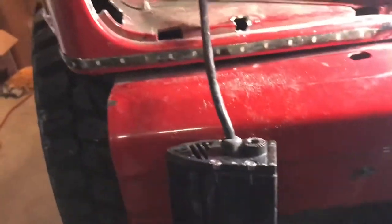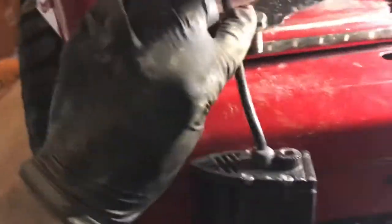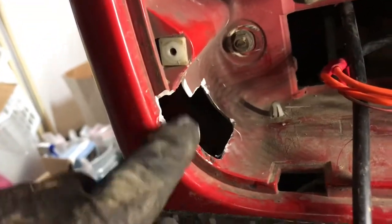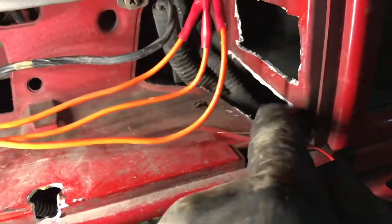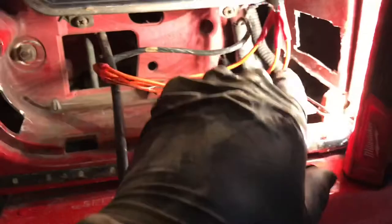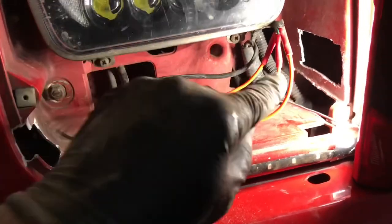You can see the overall design a little bit easier now. I drilled the hole for the bolt plus this front right up here — that's just held in by that washer. Then I cut a hole in the middle so it could slide right in and bolts up underneath like I showed earlier. You have to cut out right here to make it fit, and then here and here. So yeah, you do have to cut a lot. This is what I meant by the wiring mess I have going on. With these blinkers, since it's an LED and it's low current, I need another blinker to run the other side. The other side works but this side does not.